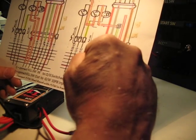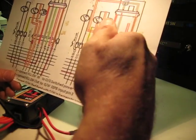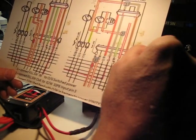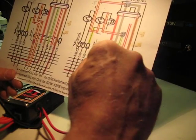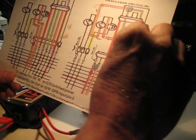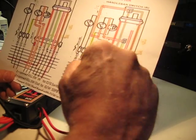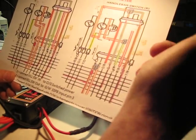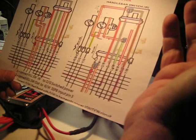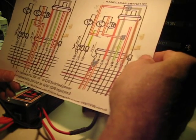We need to make sure that the rest of the ignition circuit is being powered. Remember, before it was all being powered through the kill switch, as we see here, but now that it's been separated out, we have to jumper this over. The best place to do that is on the harness side. You could do the connection on the 2 wires you cut off on the back side, on the kill switch harness, but there's no point in going through basically 4 pins here, because you'd have 4 crimps and the mechanical interference fit of the 2 connections, and that's just 6 connectors that create more power loss for no point. So connect these 2 wires and solder them with some heat shrink.